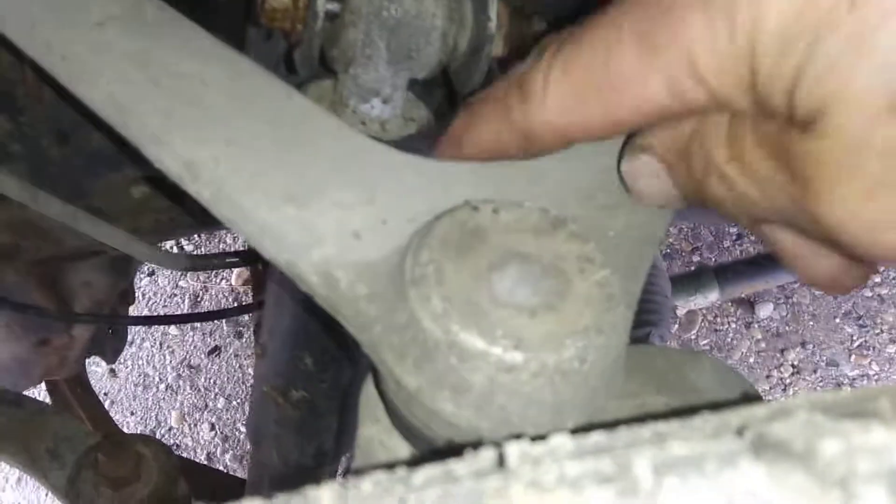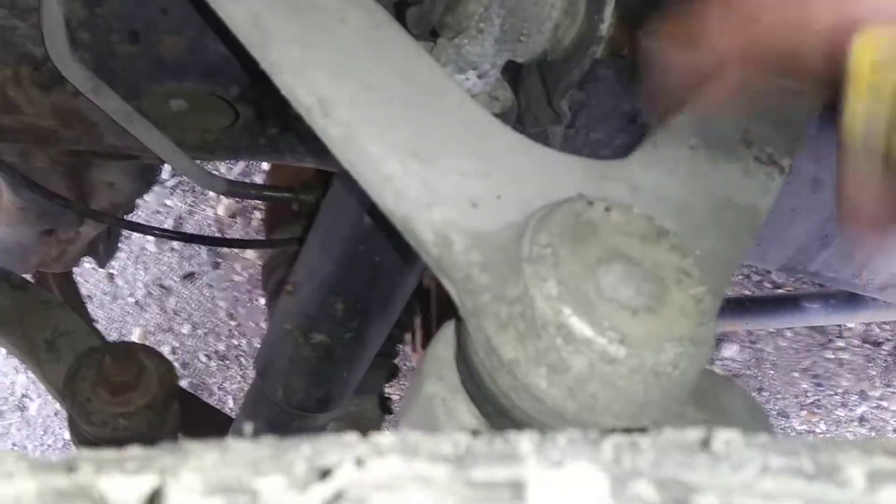Your suspension here — this is your upper control arm — I'm not seeing any issues with that. I've got a jack under the front, and this upper control arm is good and strong with no wear, which is good. Under the front left, the shock is good and dry. The CV boot is not ripped, front or back, inner and outer. Everything is intact in the front left.